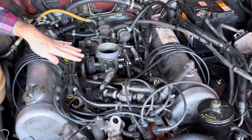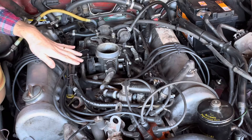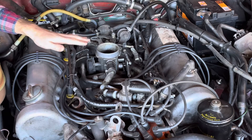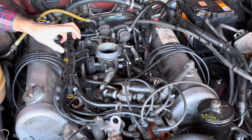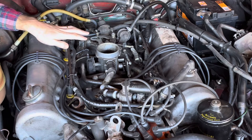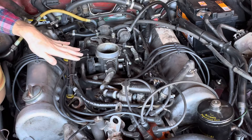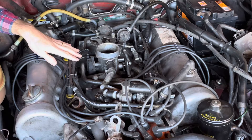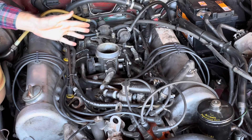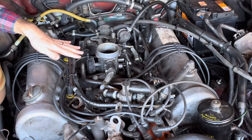I'm not sure why it was high — at first I thought maybe the regulator had failed, but I suspect someone at some point turned the fuel pressure up in the mistaken belief that would solve some other issue. D-Jet doesn't like running at really high pressure — it's not designed for it and damages parts in the system. If the pressure is much higher than about 32 psi, that's just as bad if not worse than low fuel pressure, so if it's acting up at correct pressure, the problem is elsewhere.